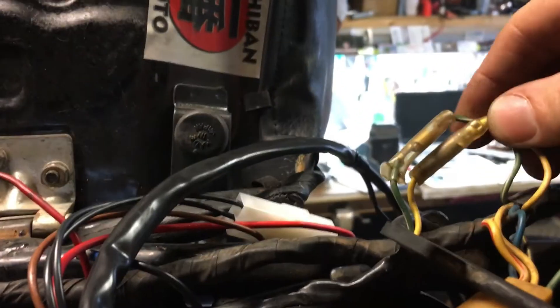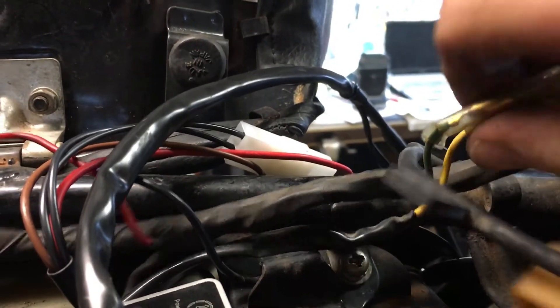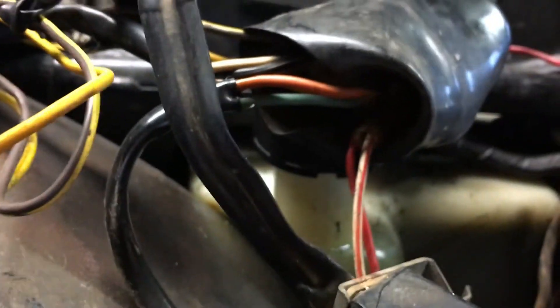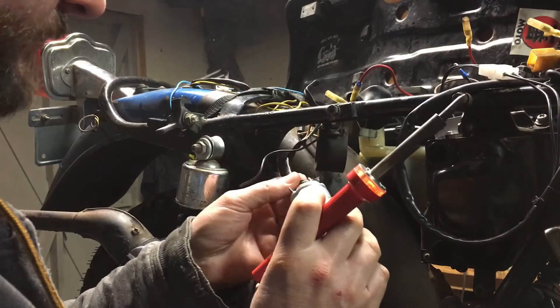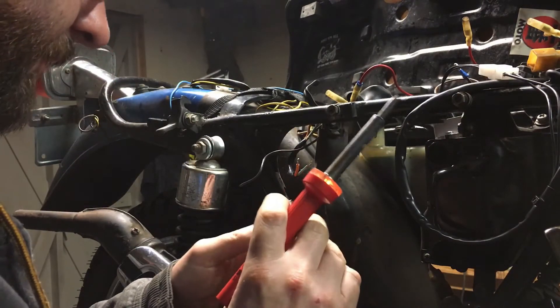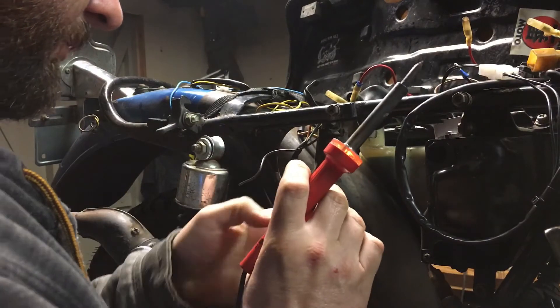You can follow that wire and you'll find this connector with a yellow and green wire — you can disconnect those; they go to the resistor. We're not going to use that anymore, just for the lighting. That wire comes down through here, and then this rectifier goes into your big connector. Here's the turn signal — I've just cut this one off, left the pigtail alone.